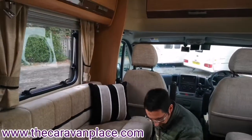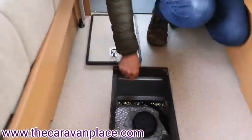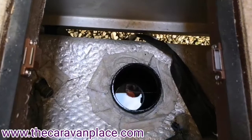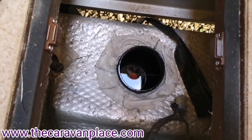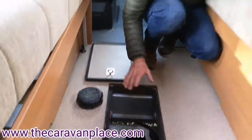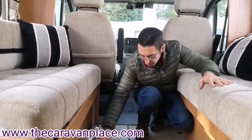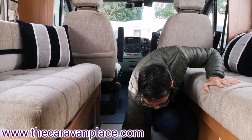If we need to drain our fresh water tank off we literally just take the cap off - in the very bottom there's a little red bung and we literally just put our hand in and remove that bung, which will then drain our fresh water supply. Through the winter we're going to want to make sure that's all drained down fully. There is a bit of insulation around the fresh water tank but you're still better draining this off during winter, and again you can keep an eye on just how much water is in there.